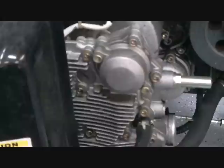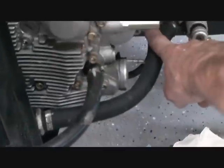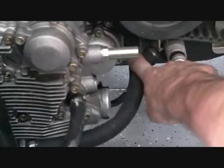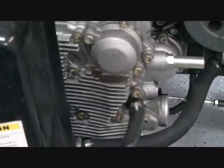When draining the oil on the SE5, you've got your oil cap here — inspect the o-ring on it. You're going to replace the drain gasket on the oil tank, and then located right below the gearbox positioning sensor is your engine oil drain — replace that gasket too, and inspect the o-ring on the oil filter cap. Putting a pan under the entire unit will speed up the process; about 20 minutes on an SE5 is a good time to get all the oil out of the transmission.